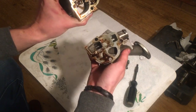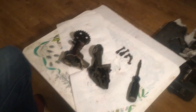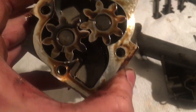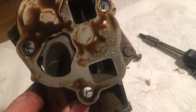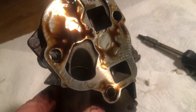You've got two gears in there — suction up through here. Oil is drawn in from that side, pulled through your gears, and pressurized up into the block. In here you have your pressure relief valve. There's a spring in there, and when the pressure reaches a certain amount — I think it's around three bar in these — it opens and bleeds off the excess pressure.